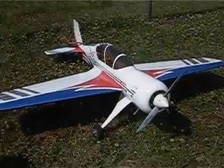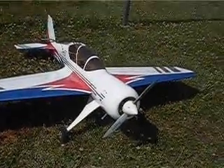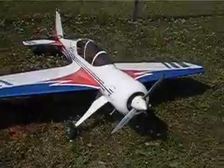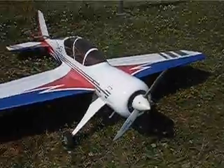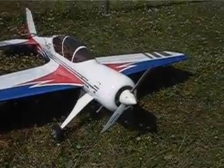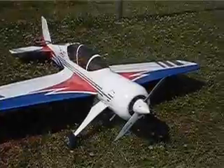I had this spare one and thought, why buy a new one when I could just mount this LA engine in my new plane? But there is some problem — it has a bit too little power, so I thought, why not tune it a little bit. The first part I tuned is the silencer. There are three chambers inside with walls separating them and holes where the exhaust gas flows through. This silencer is known for its big airflow drag and not only muffling the sound but also the power. So I enlarged all the passages to approximately twice the diameter area, and this already gained a lot of power.